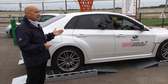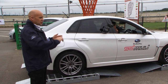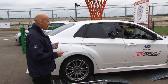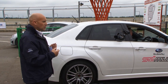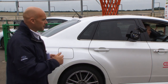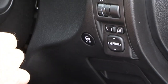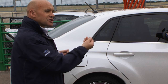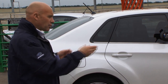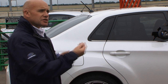On an STI you've got three settings for your traction control and stability system, which is unique to the STI. In standard mode when you start the car the light goes out and it's all active, looking after you. That will allow a little bit of braking if it's slippery but it won't let the revs go too high so you can't spin the car through a corner. A momentary press on the button brings a green light on — that disables the restricted engine side so you can still rev it, but it also enhances the braking effect. In snow the green light mode is really good because it puts more brake pressure on the wheels, and if you've got a very slippery surface with a little grip here and there, the brake system will cut in and help you get clear.